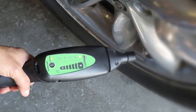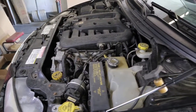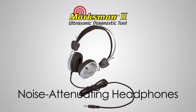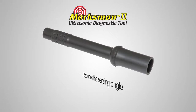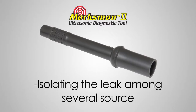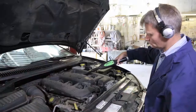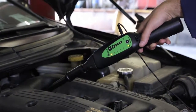It's pretty obvious this tire has a bad valve core. Crowded engine compartments and lots of hoses make finding vacuum leaks difficult for some ultrasonic testers, but not for the Marksman 2, thanks to its precision-engineered hollow air probe and noise-attenuating headphones. The air probe reduces the receiver's sensing angle, which helps isolate the leak among several sources. The headphones muffle the noise in the engine bay and also cut off the audible alarm, initiating the Marksman 2's advanced heterodyne circuitry and sound signature technology.